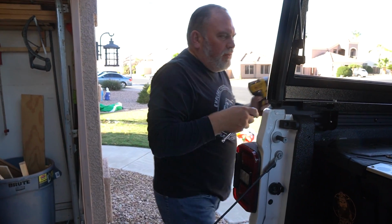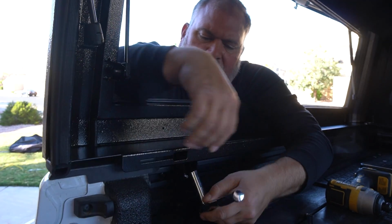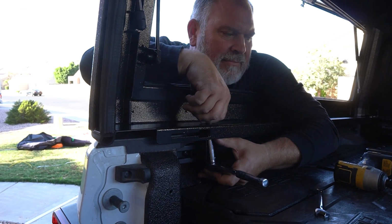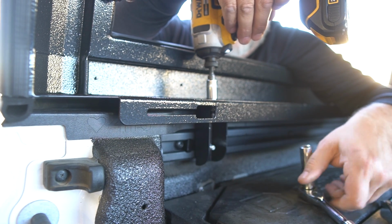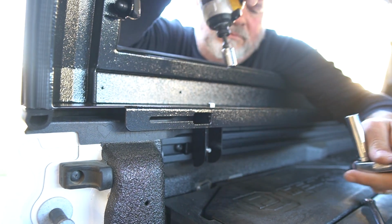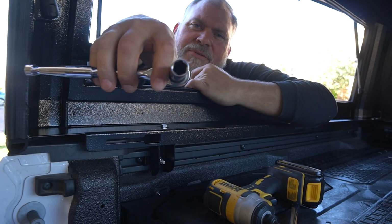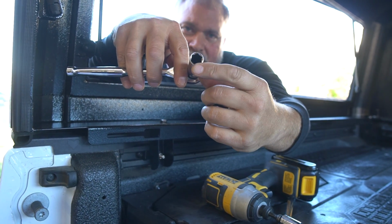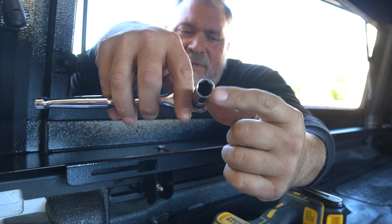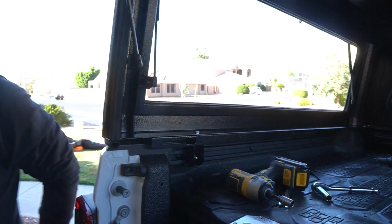Try to work around that underneath this lip. It's pretty hard to get this wrench underneath there. So we're going to put a deep socket on the nut. So you've seen me struggling with this socket, and I don't know if you can tell or if it'll focus on here, but you can see that it's actually damaged. The flat parts are rounded over and they're kind of crooked, so that's probably the reason it's not fitting on the nuts very well. So what I'm gonna do is swap this out for a different 1/2 inch deep socket.